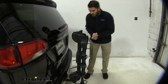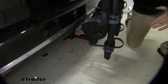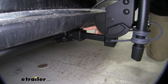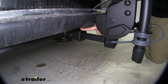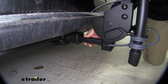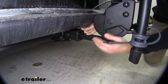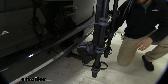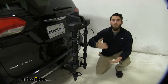Let's look at how it attaches to the hitch. With this Pacifica we have a 2-inch by 2-inch hitch receiver. What's nice about this bike rack is that there's a sleeve on the end of the shank making it compatible with that 2-inch receiver. But if you have another vehicle in your household with an inch-and-a-quarter receiver, you can remove that sleeve and the shank will fit those hitches as well — so it works for multiple vehicles and you're not limited to just your Chrysler. We also have an anti-rattle bolt tightened down, which takes away the shake and play so you won't hear rattling while driving or see your bikes moving around a lot.